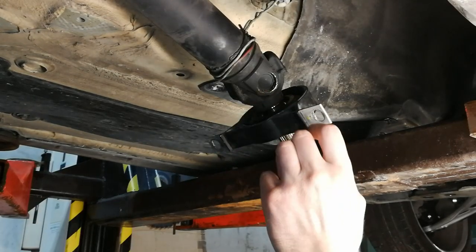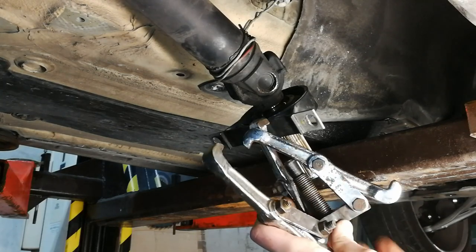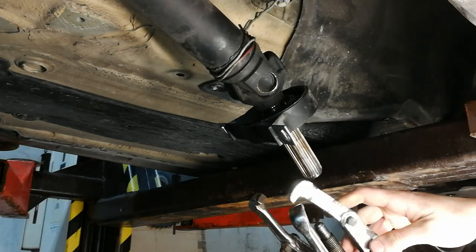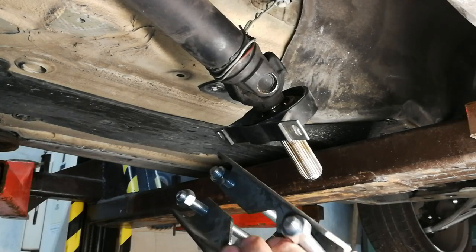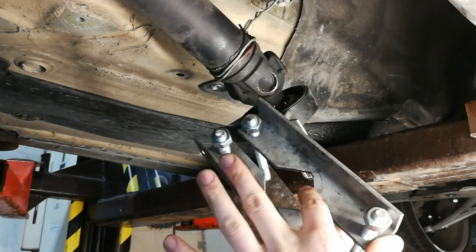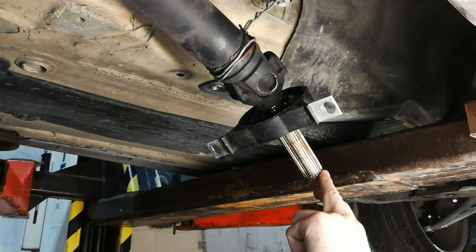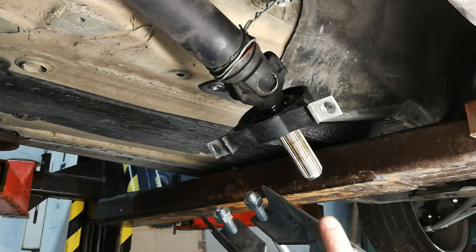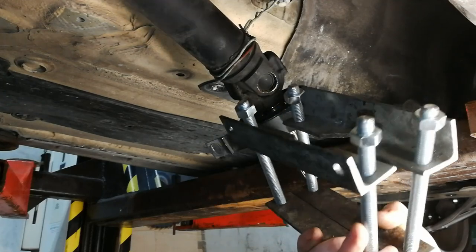Now we have to remove the metal clamp and take out the central support bearing. To get the central bearing off the shaft, use a puller or bearing removal tool. A long puller can grab around the aluminum console and pull it from the shaft. My puller isn't long enough, so I made my own tool from threaded rods and profile steel — it grabs around the bearing and I can pull it off using nuts on the threaded rods. I'll also put a link to a proper bearing removal tool in the description.